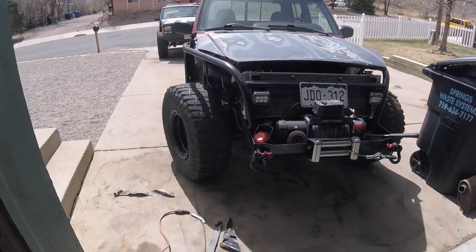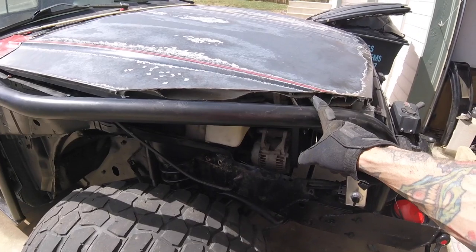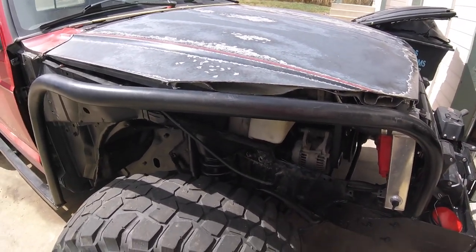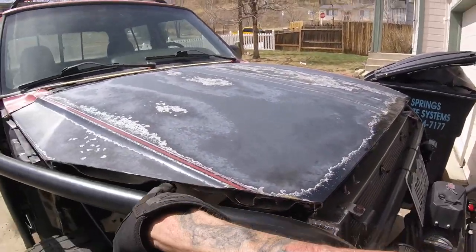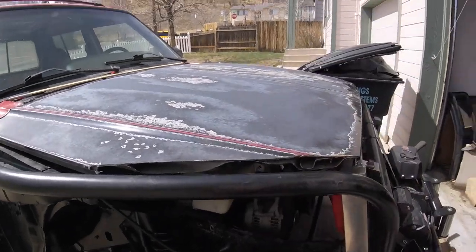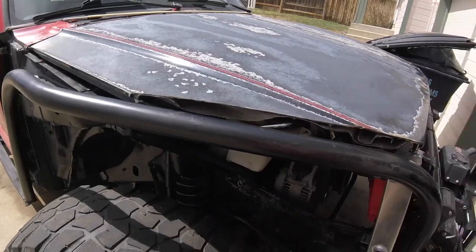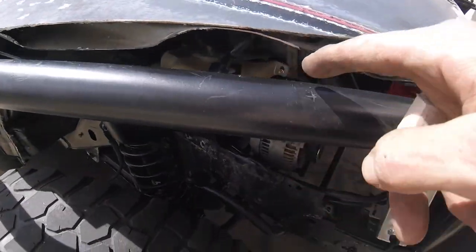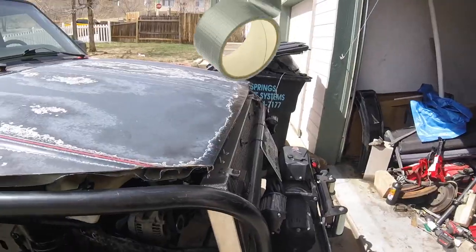With the hood technically mounted up, I can move to boxing this in, making a holder for this, and making a latch or some tabs with hood pins. I'm going to go ahead and weld that up — that'll hold it in place. I've added little tabs on either side, and then I can go pick up some hood pins and that'll be done.